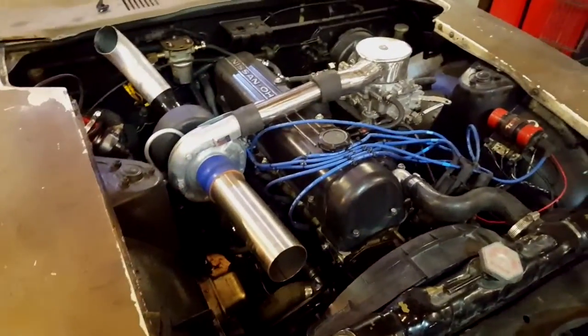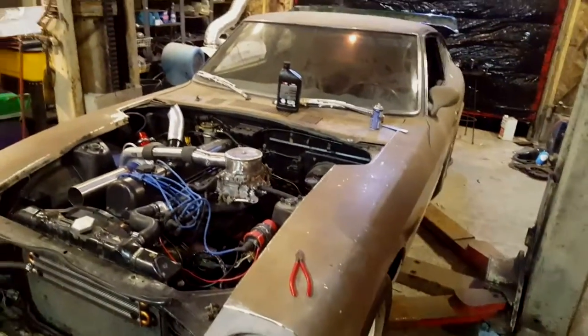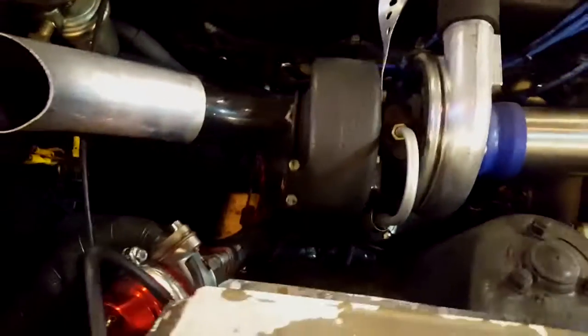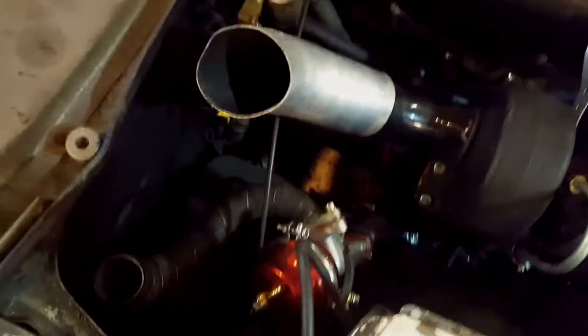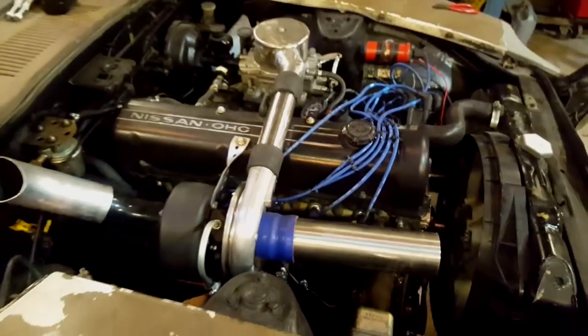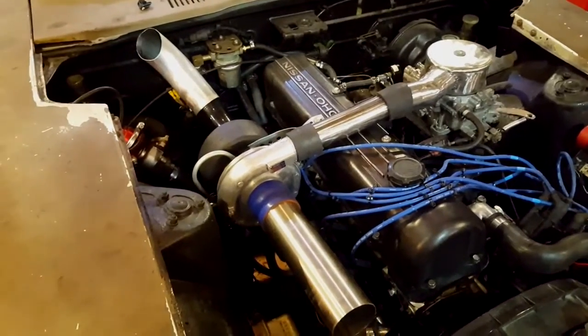People asked how the turbo is on the other side — I made an exhaust manifold that routes around the engine. The pipe goes down, goes underneath the oil pan, routes around, comes up on this side, and just fits past the starter — super tight fit past the starter and oil filter. I made a dump pipe that came up through here for the wastegate, which I got off Craigslist. It's set to six pounds of boost right now, which is a perfect starting point. I have an electronic boost controller to install as well.